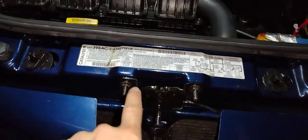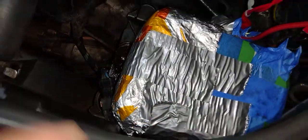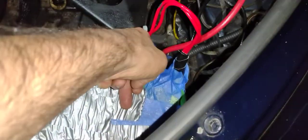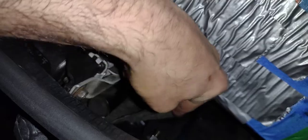I fluid filmed everything — you can tell the fluid film stays on there, which is great. I did that to all the metal pieces over here where I was starting to see a little bit of rust. I could polish these up and they really aren't all that bad. The battery — since I went ahead and put that on, it's been really cool, believe it or not. You want to go ahead and get all these areas and do this right, and block off the area where the battery is, and then after that you'll be just fine.